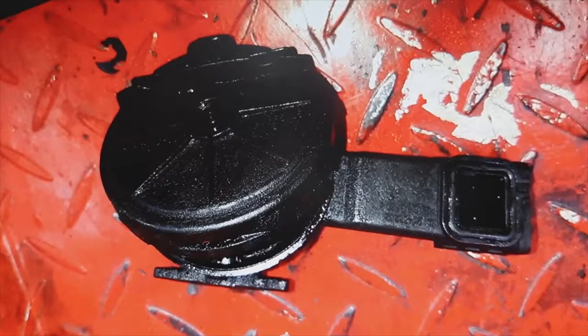I have made a small video here so you can see what this valve looks like inside. There are several types of valves. Some of the most typical problems is that they get blocked because they get clogged and stay closed, causing overpressure inside the engine. Then there are others, like this one in the photo - this is from an Opel Astra H 1600 gasoline - where the problem is the opposite: the internal membrane breaks. The membrane is orange and is the one that usually breaks and can crack. That spring controls the pressure - look here, you can see it is cracked.